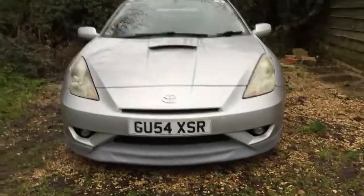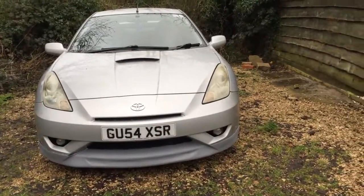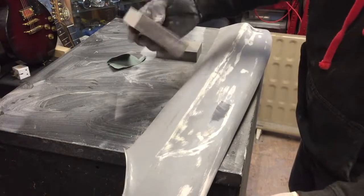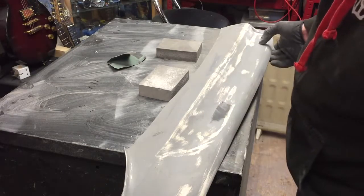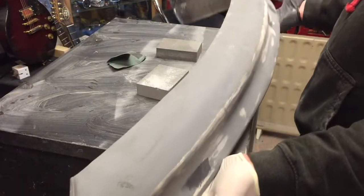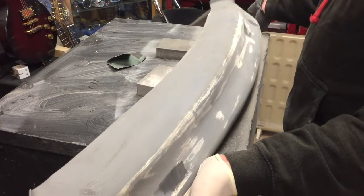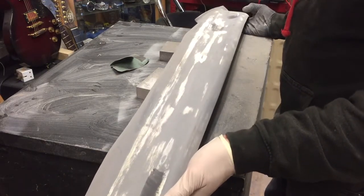All sanding again with a finer grit this time just to get all the shapes and lines right, and then I'll do the high build primer. So I'm taking the front lip back off and I'll start flattening it with the fine sanding blocks. I'm actually improving these lines now — I've done a little bit of stopper work for some pinholes. What I'm going to do now is continue with this, get it all nice and smooth, get all the scratch lines and mark lines out of there, and then in the next video we'll get onto the high build primer, flat that, then do the silver and the clear and get it on the car and see how it looks. I hope you'll join me in that one — if you've liked this video please like, comment and subscribe, and I'll see you on the next one.